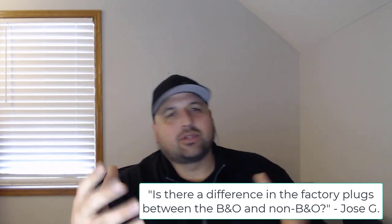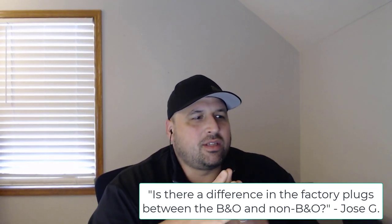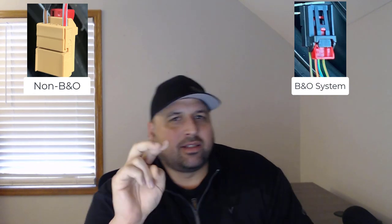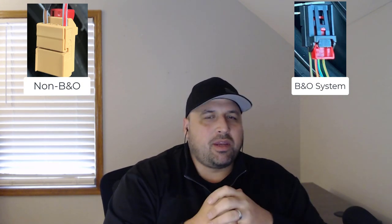The next question that I have is from Jose G. Is there a difference in the factory plugs between the B&O and non-B&O system? The answer to that is yes, there is. On the non-B&O system, it's a two-plug system, which means the 40-watt speaker only needs a positive and negative to run that speaker.